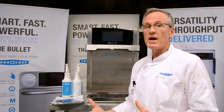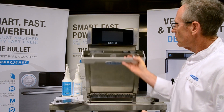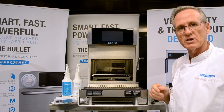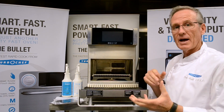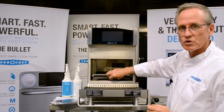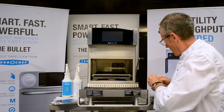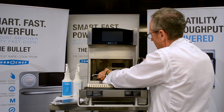In order to prepare your oven to start cooking, first we need to guard the oven. You need to open the door of your oven and close the panini press, and then once the panini press is closed, we can then start removing the cassette. The cassette will come out as one piece, and in order to do that we need to undo the thumbscrew at the front. Once we've undone the thumbscrew at the front all the way, put it aside, we can then lift the cassette unit out as one piece.